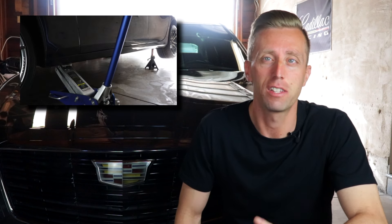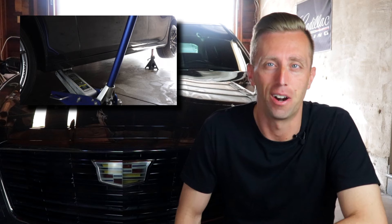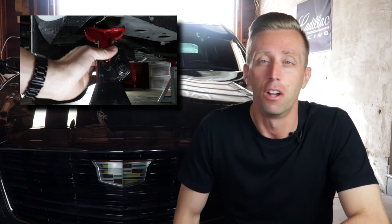Now this will depend on what kind of jacks you have — jack stands or ramps — but I'm going to show you with what I have and some alternate suggestions with other tools out there. Please remember that jacking up your car is a dangerous thing. You've got to be careful of the car's balance on jack stands and the fact that jacks are not stable. You should never get under the car without putting the car on a solid jack stand. Also, not all jack stands are created equal — make sure you have jack stands appropriate for the weight of your vehicle. You should check out the video from the hydraulic press channel where he tests out different jacks and jack stands to see how they hold up.